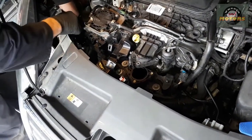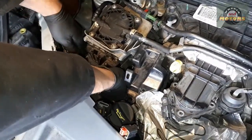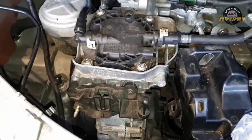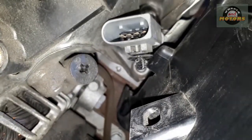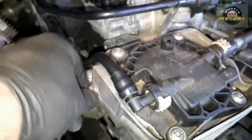There are two 10-millimetre nuts here. Once those two nuts are removed we can remove this little cover and see what is holding the fuel filter. The fuel filter is held by four fasteners: there's one nut there, then one bolt just there, then one through this hole — a 10 mil nut — and then we also have to disconnect this bolt that goes in from the side.